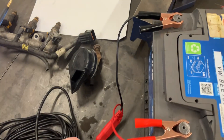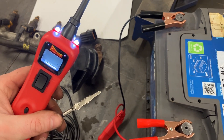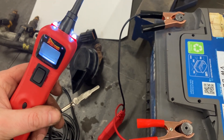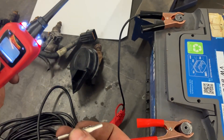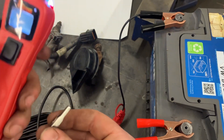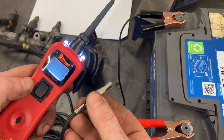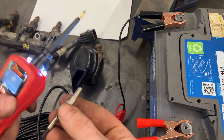There are two different types of systems in a car that you can test. Some are body-earthed — for example, a wiper motor or a bulb will be earthed locally where that component is and return through the chassis back to the battery. In that case you'd use the probe as your positive and clamp the earth wire on the engine bay or locally near the component you're testing to complete the circuit and deliver battery voltage.